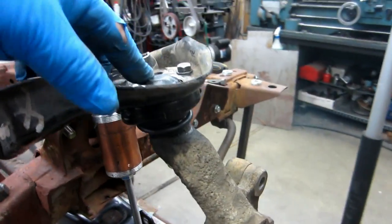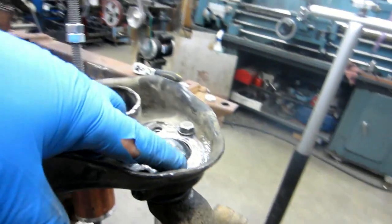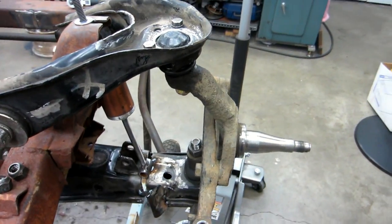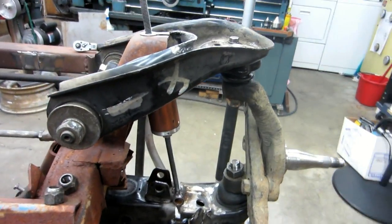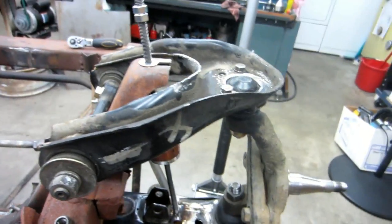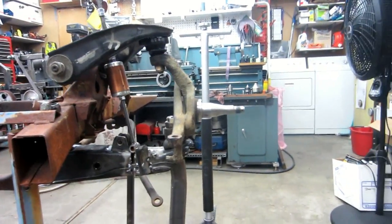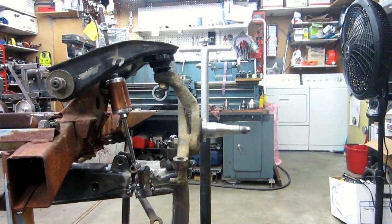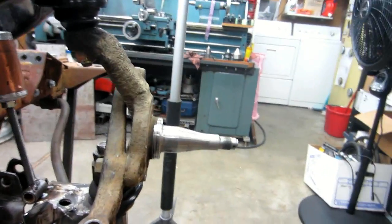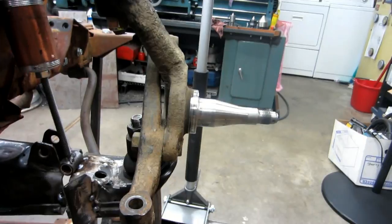I took the lip off the 720 arm — wasn't real pretty, there are other ways I could do it to make it prettier, but I just needed it flat to take that off so it would sit there. I don't have any spacers in and it's not even bolted in yet. I don't know how well it'll come out without measuring it, but there's definitely some negative camber there.